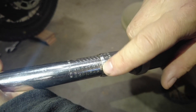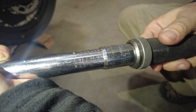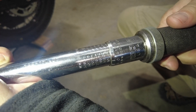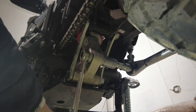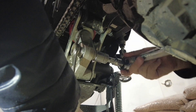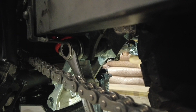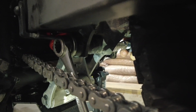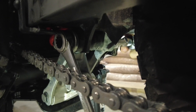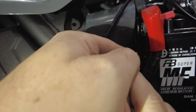For the next one, it looks like it's set up for 104, so we'll go up to 104 and then back off 6 to get to 98. Now that we're set for 98 newton meters, we'll tighten this nut. Now we'll move up to this other top section that holds the swing arm on — 98 newton meters as well. Tighten. There it is. And finally, let's put this little 8 millimeter bolt back in there.